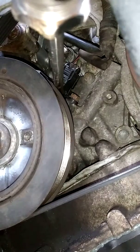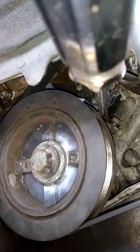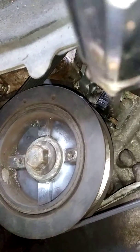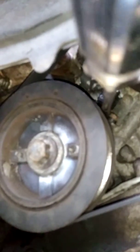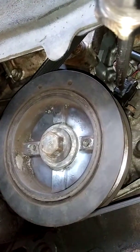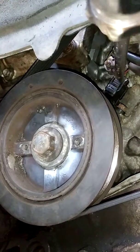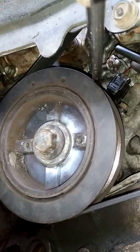Hit it a few times — if it turns over, then you know the crankshaft sensor is the issue. You just have to take this little bolt here, I believe it's maybe 10 millimeters, pop it out, take it to the local auto store, have them replace it by year and model, pop it back in, clip it, and boom — you're good to go.